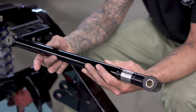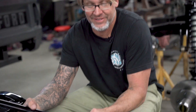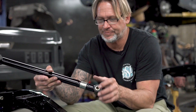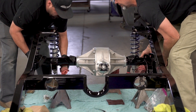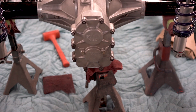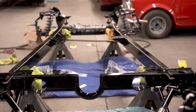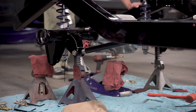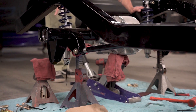These were the best invention I ever came up with. If you've ever put a four-link system together on a rear end, they usually have a male thread with a jam nut and you've got to undo all the hardware, guess, then wrestle it back together. Now you don't do that — you leave it all connected, use a little spanner wrench, and you can adjust everything in or out, your pinion angles up or down, center it. It's amazing. I can't believe in a hundred years of cars it took that long to come up with that idea.